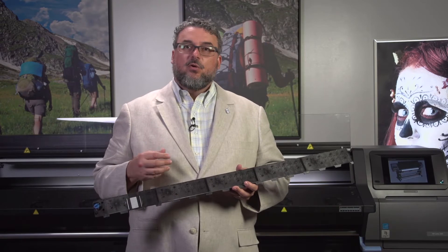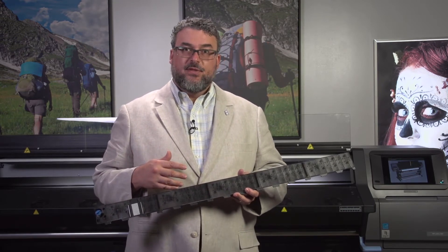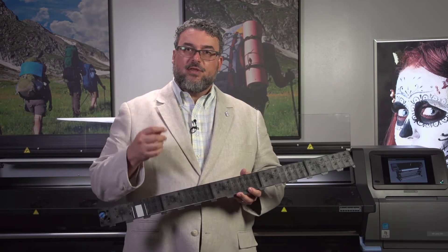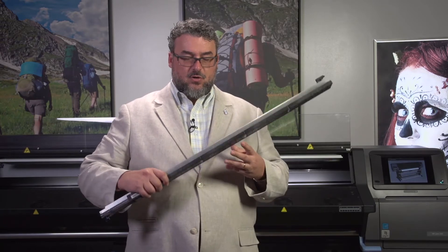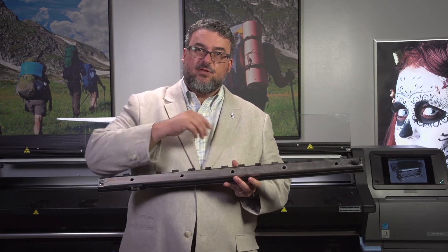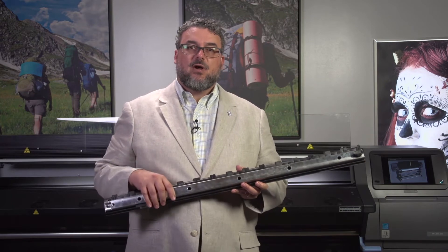It's a paper, a lot of non-wovens. Non-wovens are paper-based, and some of them have a nice textured surface. If you're applying vacuum to them, what can happen is little pieces of fiber — very, very small — get pulled. There are tiny vacuum holes all across the platen, and those tiny vacuum holes have another little hole where there are little rubber gaskets. That's where the vacuum attaches, and when these insert, the hole is sealed by a little rubber gasket, providing an excellent base for how the vacuum works.